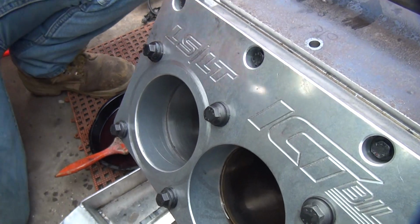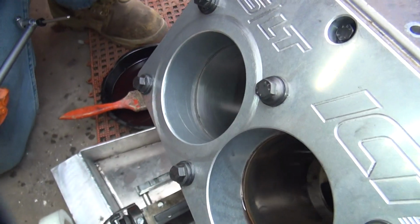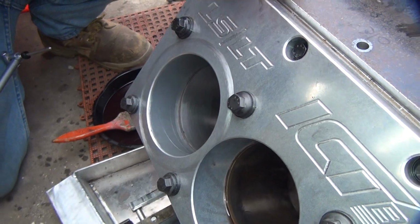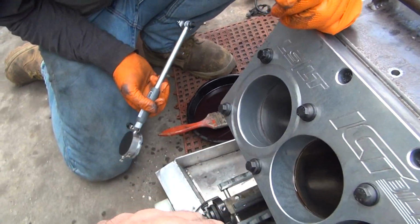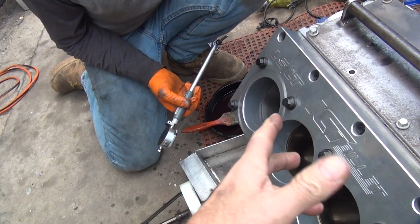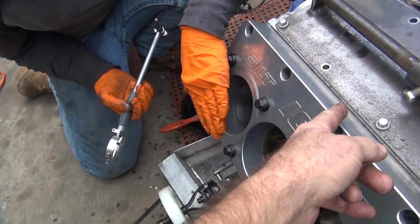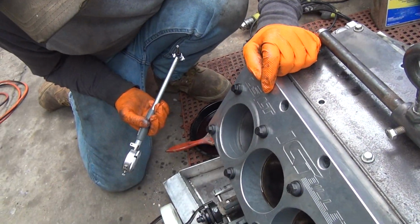And it appears the stones are full of slurry. So technically you don't have enough grit on there. Now see how flat your hone pattern is? Yeah, because you're not stroking fast enough. I slowed down too much at the top. And at the very top, you stop. Well, you kind of messed with my rhythm because you were telling me not to come out too high, so now I've got to get back. Also, when you're stopping, you didn't move it anymore. You came up and held it there. You got to stop at the bottom of the stroke. When you come up, it slows down and stops at the top.